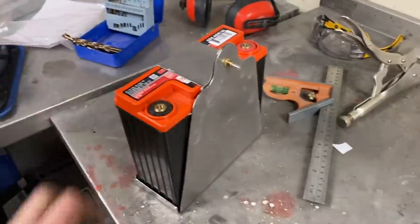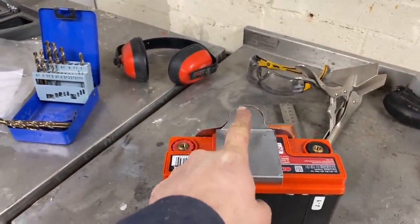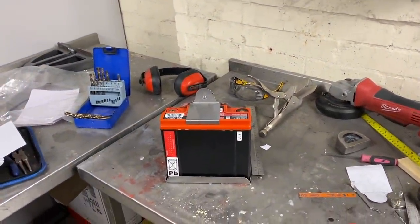There is the battery holder - really annoyed, it's off center for some reason. This back bit and the paper template - I've just been and measured all this out and for some reason it is 5mm off center which is absolutely infuriating. But can't really do a lot about it now, I'm running out of time, I've just got to get all this done. So I'll be remaking that - I've kept the original template. We're going to go around the back and I've drawn it out so it's actually in the center. But it's going to have to go in for now, so we're going to put this in the car and work out where it can go and drill through, then we can weld the studs to the bottom of this.